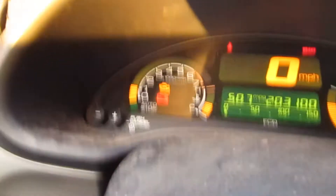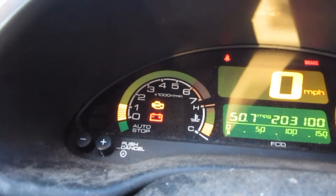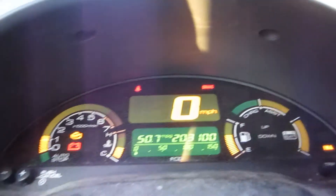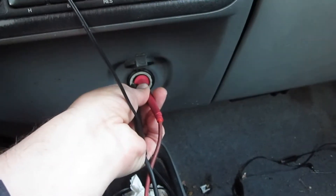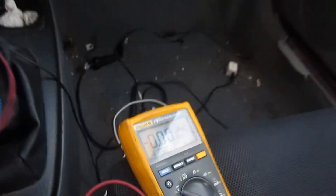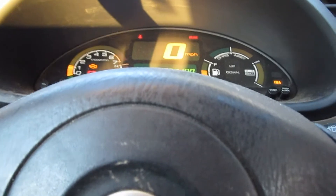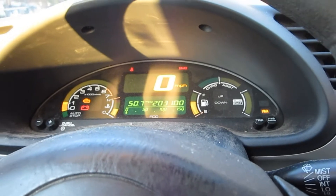We have the battery charging light on and the brake light on, and you know there's trouble. Let's check the voltage. So we're testing the voltage, and it is looking like about 11.8 volts. That's really not good — 11.8 volts. It is not charging. Sometimes if I restart it, it will start charging again, but let's try disabling the BMC and see if that fixes our problem.